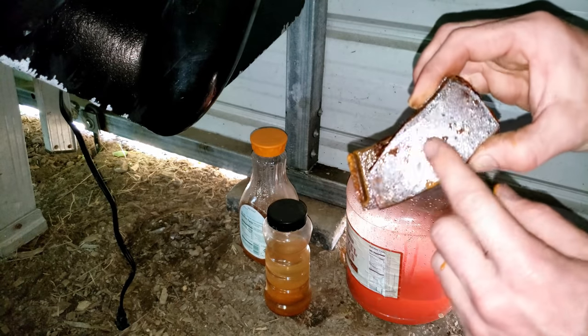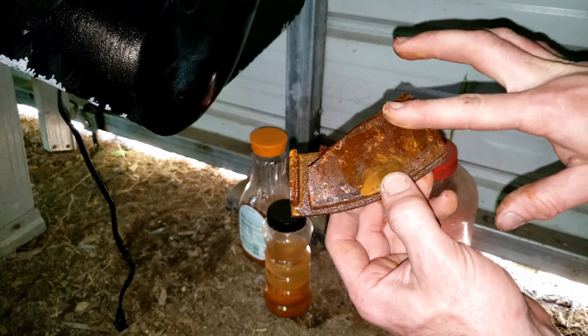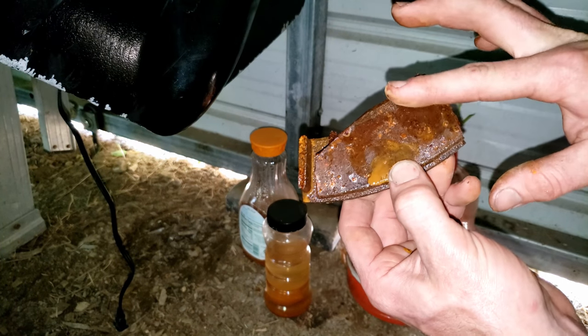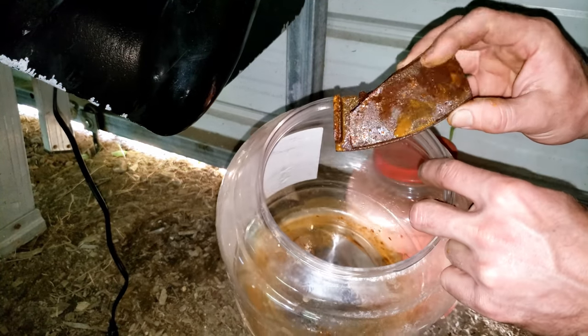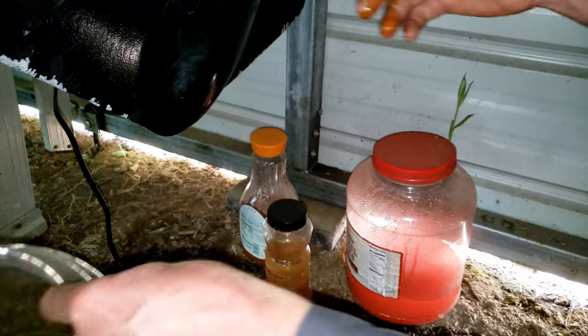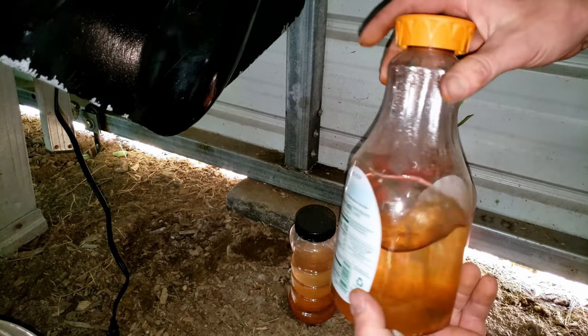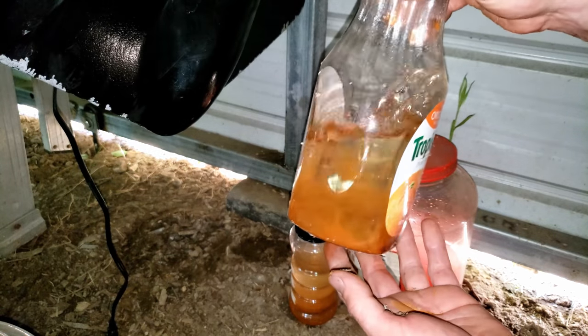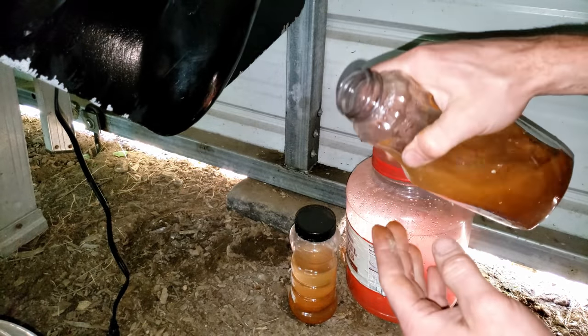Looks good. So if you store your engine block just drained, the whole piece is going to be a very humid environment in there — just sitting inside of that jug, the whole thing stayed sopping wet, but not too rusty. Now if you just left water in there, it's not looking great off the rip — tons of rust on the bottom of that.